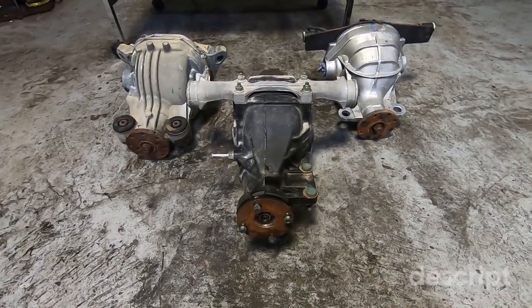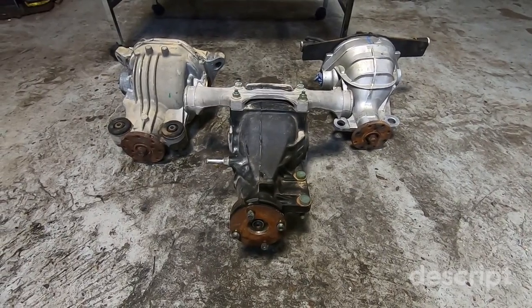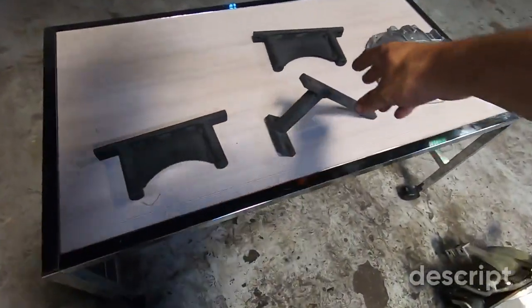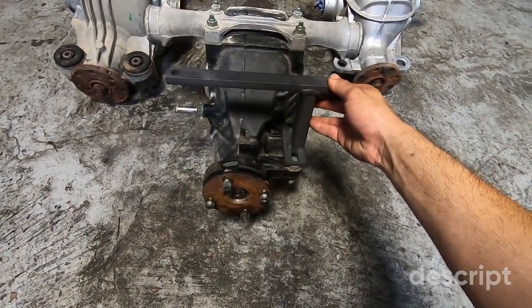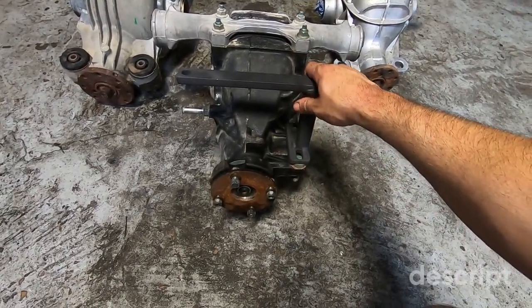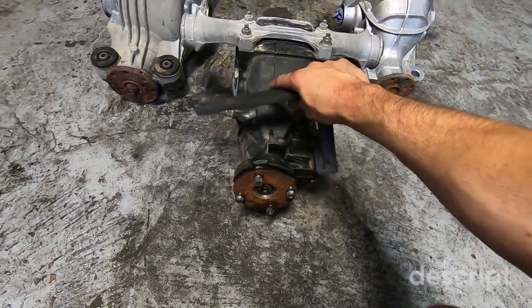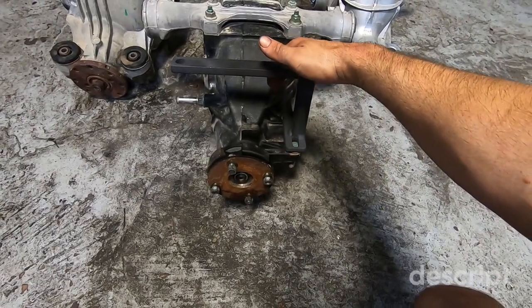The reason is because I have ripped the ears off of the subframe with this differential, because of how the nose mount has to be used. You only have one mounting point on one side, which causes a weird triangular motion and it ends up ripping the ears off of the subframe. Even if you try to use that to counter it, if you have more than 400 wheel horsepower it's still a problem.